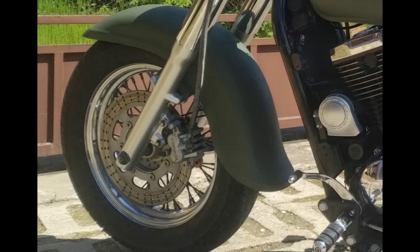The stock brake discs can handle sintered pads on all models, so if you'd like to have a little bit more braking performance, and chances are someone who owned this bike before you might have gone with a carbon or an organic or some eco friction brake pads. So if the braking performance is lackluster, go ahead and try sintered brake pads. They perform really well, if the brake disc is still good, that is.